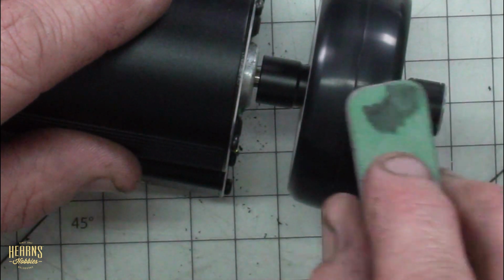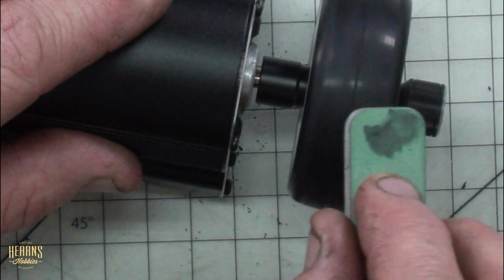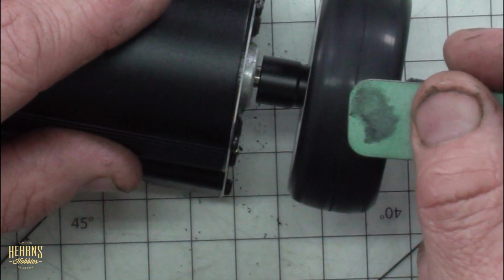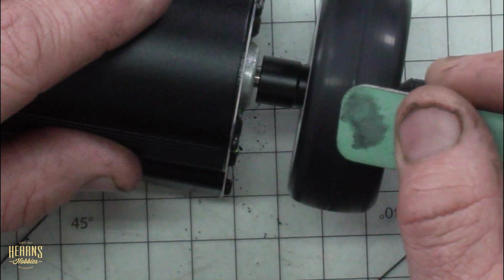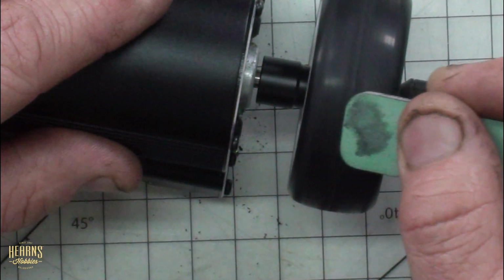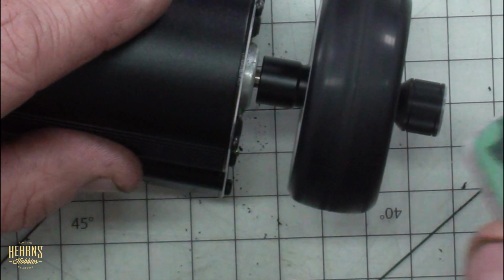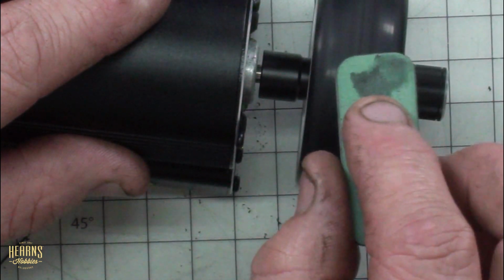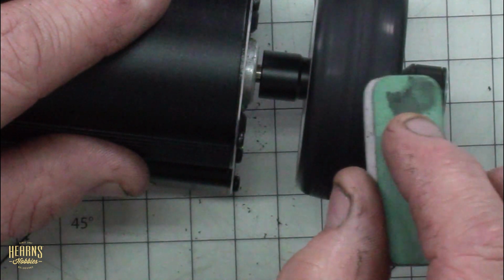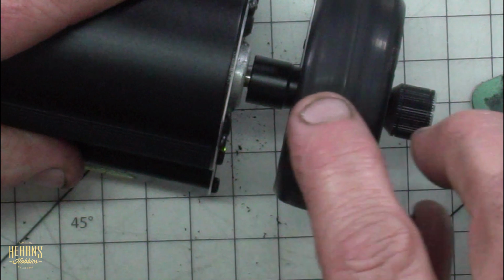You got your sanding pad on there? I can see the sheen coming clean off that tyre. And you're just going to concentrate a little bit more on that centre line? Yeah, just break that. Get rid of that. Don't want to sand the whole tyre too hard. And it's funny, as you can see with the old tyres, they don't actually wear in the middle the most. But you do want a nice amount of meat there, because that's where we get the traction. Nice and flat.